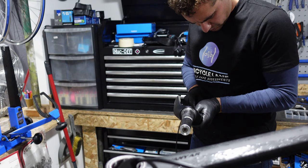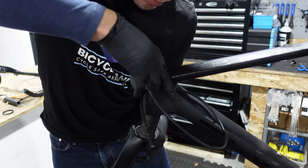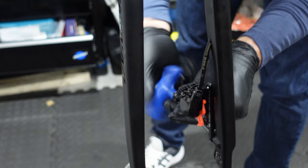Let's switch to the front brake routing and mounting. We push the cable straight through the forks from bottom to top — it went through a treat. Once the hose is through, we're ready to push the forks through the frame. This is a delicate dance of alignment, guiding those hoses to ensure they're in the correct orientation. Remember: in the UK, front brake on the right, rear brake on the left. For mounting the front brake caliper, add a little grease to the caliper mounting bolts and tighten loosely — we'll align it properly later.